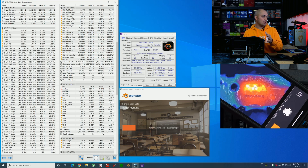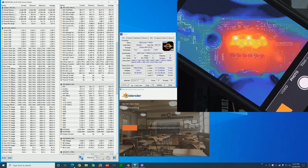As you can see in HWiNFO, thermal throttling has been triggered. Once the temperature hits 128°C — which is above spec — the system drops the frequency to 500 MHz to cool the VRM down, then ramps back up, only to spike again and drop back to 500 MHz. The benchmark is still running but with a massive drop in performance. I measured the benchmark score and you're losing somewhere between 30% and 50% of performance.